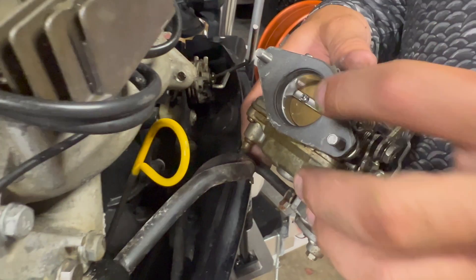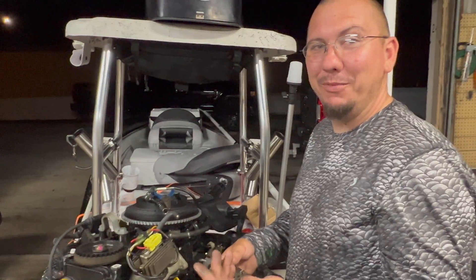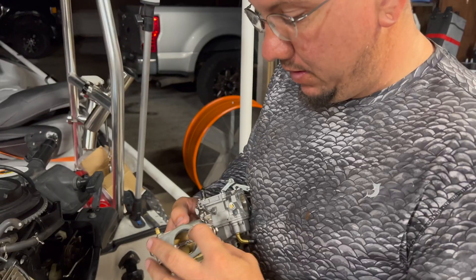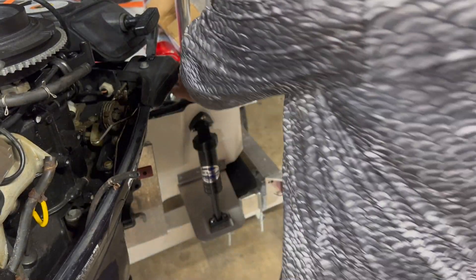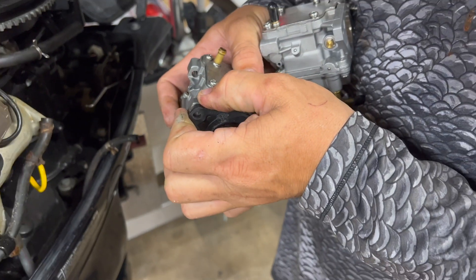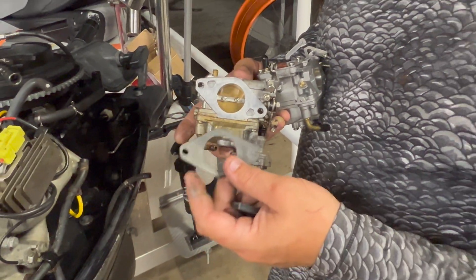You can't get it off without taking the intake manifold off, so it's off — time to pull it off, pull these hoses off, and swap it out. I ordered new gaskets and a new fuel filter; I recommend doing that whenever you do this. These are the two gaskets you want to replace. There's a spacer here you're going to reuse, so do not throw that away. Replace the two gaskets, put it back together, and you should be good to go.